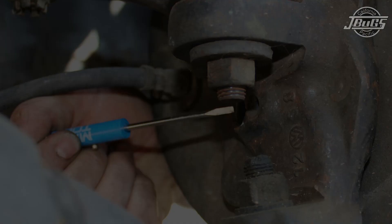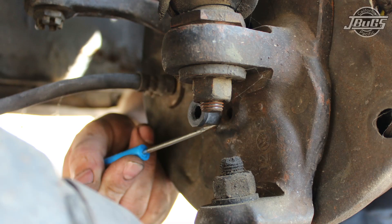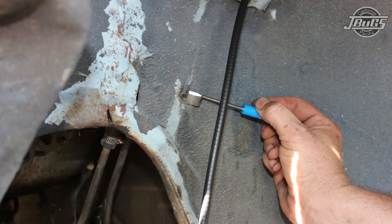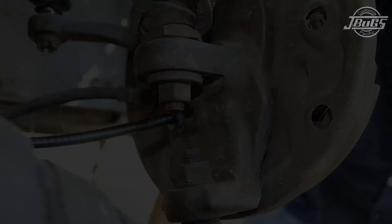On the back of the spindle you'll see a roughly 3/8ths of an inch hole in between the two ball joint ends on the spindle. This is the hole that the speedometer cable will eventually pass through, and we're going to press a new speedometer cable sleeve or speedometer cable to drum seal in place. Then position the speedometer cable on the inner fender well through the fold-over tabs and bend the tabs in place to hold the cable to the fender well.